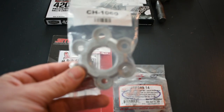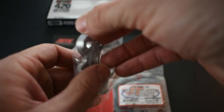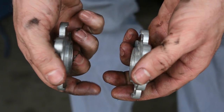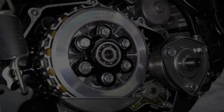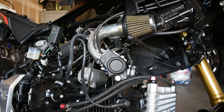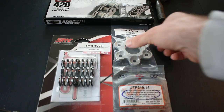The third item is the Chimera CNC clutch plate — an absolutely essential item when doing a clutch upgrade for two reasons. One, you need a stronger clutch plate to compensate for the significant pressure difference from the springs. Two, you need an aftermarket clutch plate with six holes instead of only three, so you can install up to six bolts for added stability and security to offset the stronger springs. The Chimera accomplishes both, and they make arguably the best Grom intake on God's green earth. I purchased it at Steady Garage for $39.99. So all in on parts, I'm at only $88 — and I'm doing the install myself.